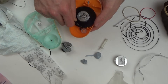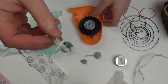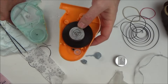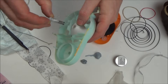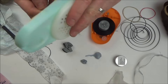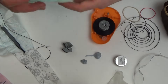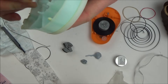The belt goes down the bottom of the record and goes inside of this white governor here. So the belt basically goes around the record and purely around the governor. Now the clever bit is this little needle here goes onto the record. It's in this position because of where the spring on the speaker sits — it's the needle that vibrates and goes straight onto this thing here, which is basically a spring that moves up and down. This thing is basically a diaphragm to amplify the sound. When the needle moves up and down on the record, it's doing little movements that create the sound.